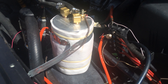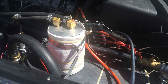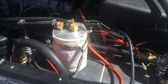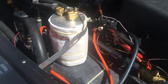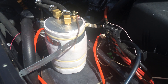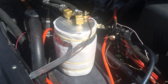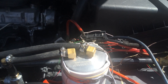This is just a 10-micron filter I got also at the tractor supply. I hope to get a 2-micron filter, but right now it's only 10 micron. I pre-filtered my oil at 2 microns before I put it in the back, so I'm fairly confident that there's nothing in there now. This fuel filter is wrapped with a 100-watt electric silicone heater, and it works very well. I tested the heat — it comes to about 250 degrees on the heater itself, so it's transferring the heat right into the metal canister on the fuel filter. That helps keep the oil hot as it's filtering it and right before it goes to the engine.